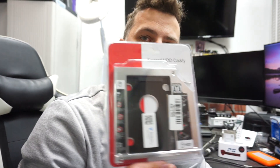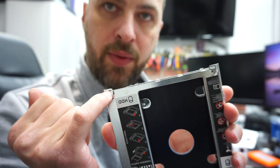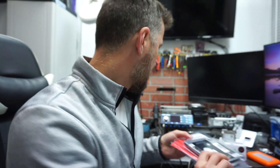In order to do that, you'll have to sacrifice the DVD drive inside this Mac, because that's where I'm going to insert the secondary hard drive. For that you need to purchase something called the second HDD caddy — you can find it on eBay or Amazon. Search for 'second hard drive caddy MacBook' because there are two versions. The MacBook Pro version has mounting holes which allow safe attachment to the body of the Mac. The PC one will work as well, but you won't have those two holes — not really a big deal.